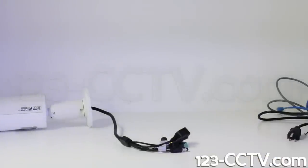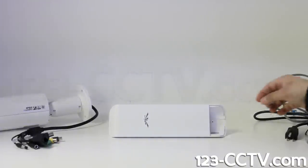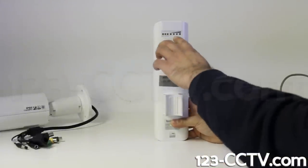You will be connecting the camera to a wireless access point. You can use a 2.4GHz or 5.8GHz wireless access point in client radio mode, such as this one which has a built-in flat panel antenna. On the back of the access point there is a wireless signal indicator which tells you the strength of your wireless signal.